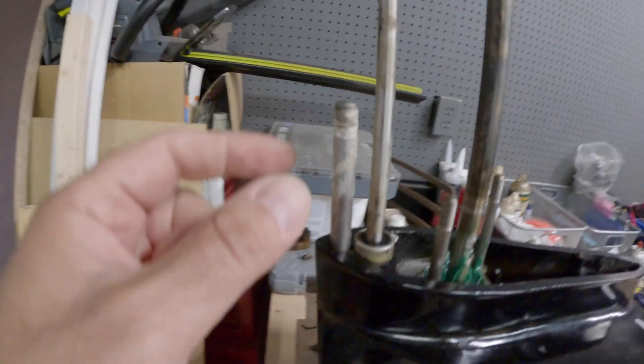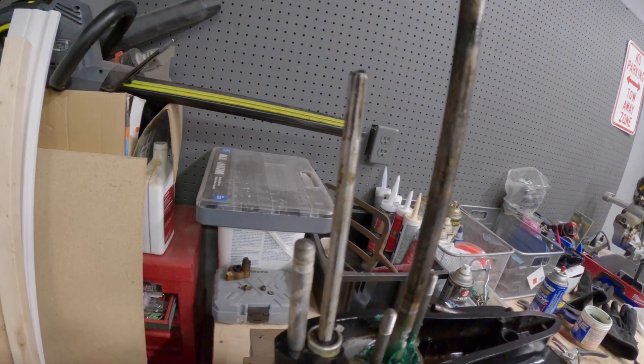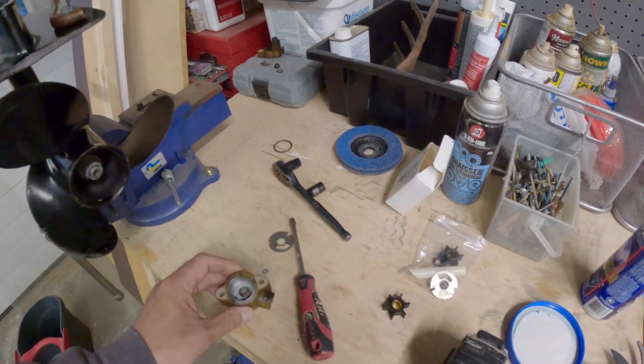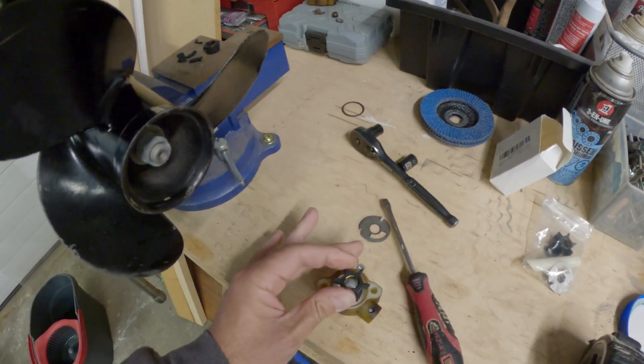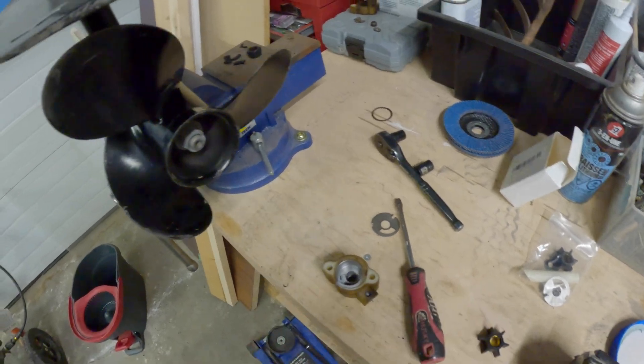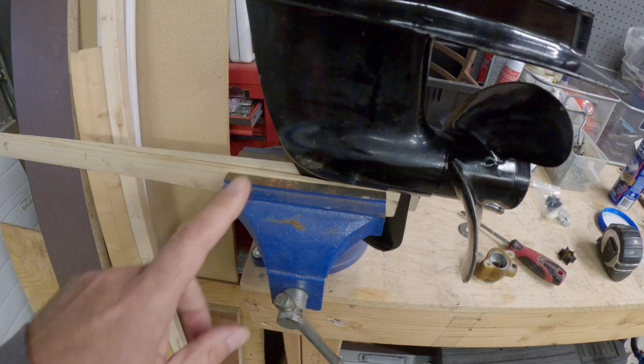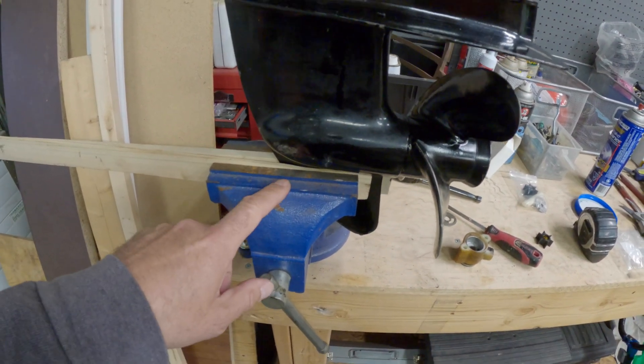To take this piece off it's pretty simple — there's one bolt in there, and another one that you screw in through the top. I'll show you guys once I'm ready to put it together. This is the part of the water pump itself, and that's where this thing sits. I cleaned it up, put some fresh grease on the bearing, and I'm just going to put it back together so you guys can see how it goes.